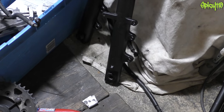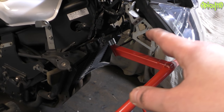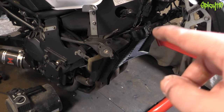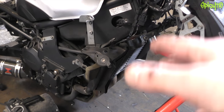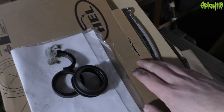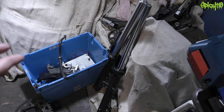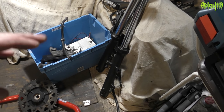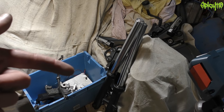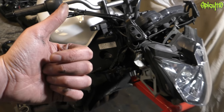They are done. I've pogoed them — pressed them up and down — and they're not leaking. They both feel very even. Other than nipping the top caps up and giving the bottoms a quick whack with the impact gun when they go back on the bike, they are done. The next video will be putting the suspension back on the bike, getting the wheels on, and changing the chain and sprockets. Fork seals are actually an easy job, especially on something like this if everything goes right — it's just sod's law that problems cropped up in this video. It's an easy job and you can save a fortune doing it. Changing your own chain and sprockets and doing fork seals are things all bikers should learn to do.